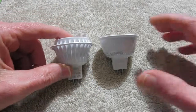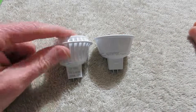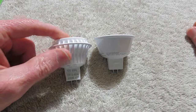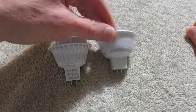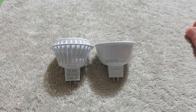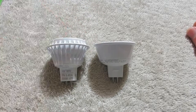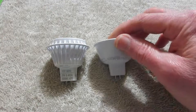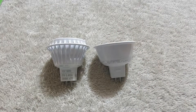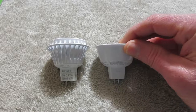You can see that the older bulb is a bit longer and it has the heat sink fins on the side. The new one is shorter and plain. The reason it doesn't have heat sink fins is because it does draw quite a bit less power. The older one I measured to draw 5.6 watts at 12 volts, whereas this one drew 4.3. And they seem to be about the same brightness.